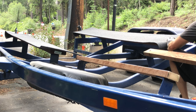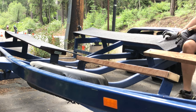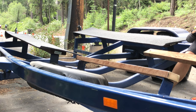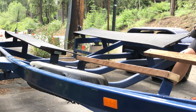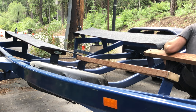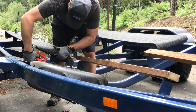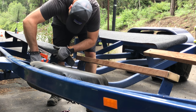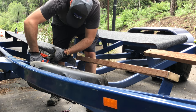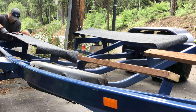As I'm trying to fit it on there, I cut it a little too long, but that's fine — just trim it up with scissors. Once you get that first staple or two into the wood, life gets a lot easier as it starts holding the carpet in place. You're going to have a lot of excess carpet in the corner areas and you'll have to trim it down. Just don't over-trim — it's always better to under-trim since you can always remove the extra, but if you cut it too short you're going to have problems.